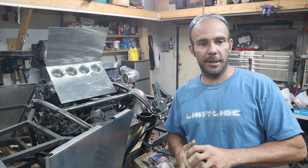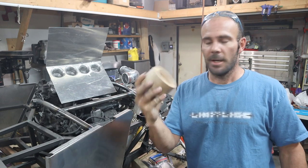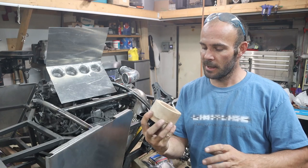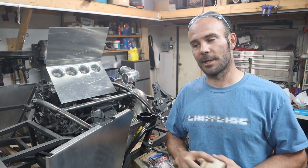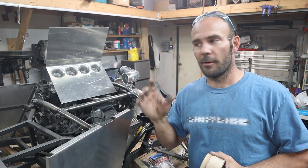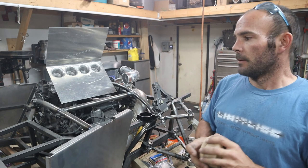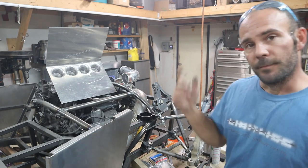I'm going to call it an episode there — thank you guys for joining me and I hope you enjoyed the wooden dimple die test. I might later on just try it on some thicker aluminum or even some steel just to see how much it'll actually work or how long it will last. It did what I needed it to do. I'm really not going to need it again — I'm not doing speed holes all over this thing. The floor is going to be like one and a half mil aluminum for the whole thing, firewall should be aluminum as well, tunnel cover all aluminum, but I don't want holes all over that stuff — I want to keep the heat in and let it all pass through the center. See you guys on the next one.